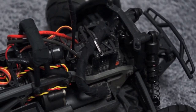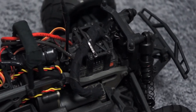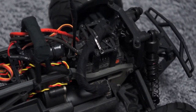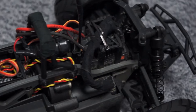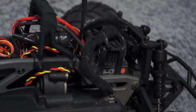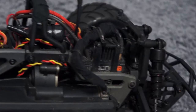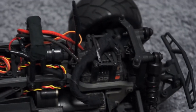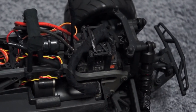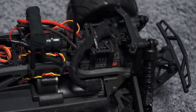But when you plug in the battery for charging, you can still see about 7.4 volts in it. So it's not even discharging properly. So something happens, so it measures the voltage of the battery incorrectly, or I don't know what. Or it just overheats and then, I don't know, disables the power. I don't know what it is, the protection logic within the Vapor Pro. But it does not work well anymore. So I would need to replace it if I would like to run this car, because otherwise it's just useless.